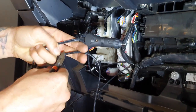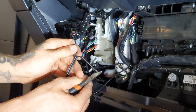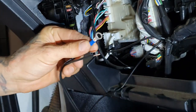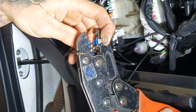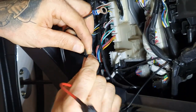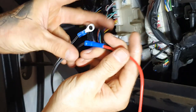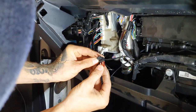Secure the cable firmly along the cable run to prevent the cable moving freely about the cabin. Prepare the power cable for the Cel-Fi Go. Cut the power cable to 40cm and bare back the two ends ready for direct connection to the car. The side with the writing or the trace is the negative.